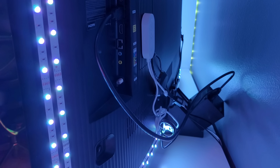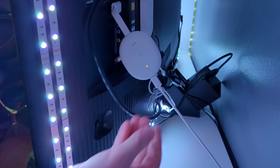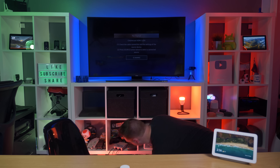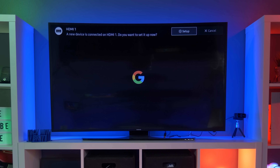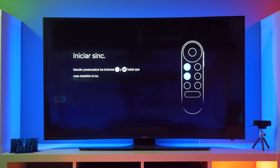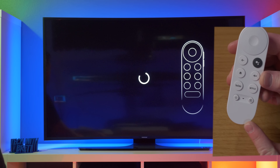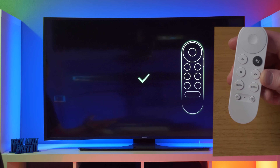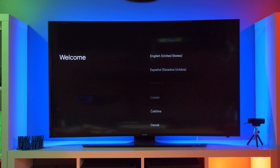So now we're going to get to the back of our TV and find an open HDMI port. We're going to plug in the new Chromecast, and then we're going to plug in the power cable and plug the other end into the wall. If you don't see the Chromecast, you do need to switch the input on your TV. So once we plug it in, it boots up. And the first thing it asks is to pair the remote. You're going to do this by holding down the home button and the back button to pair. And there it has been paired. So now we're going to use the remote and choose our language.